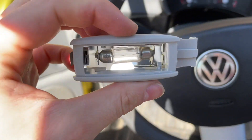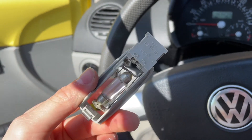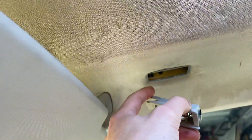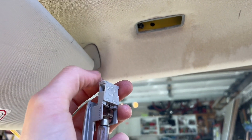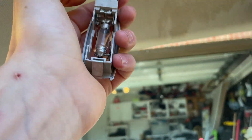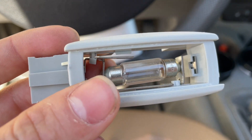If you make the mistake and accidentally pop the lens out, it's no big deal — run a tiny little bead of super glue along this line and just pop the lens back in. It's not too difficult to get this out. Right here, just push in with a screwdriver and like the other clips, try and make it click up against there. Push it up, then go to the other side and do the same thing. The other side has a prong but it's a little hard to reach. Once you get it out, pop pop and pull it out. Same thing on the other side.